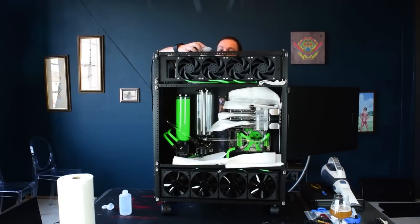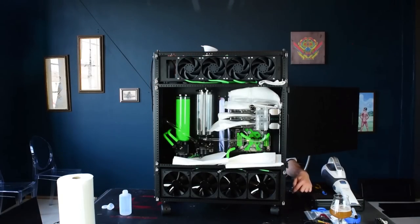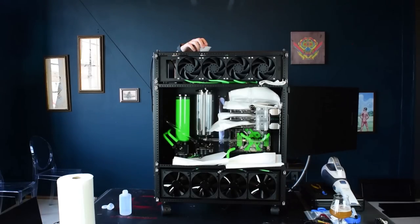That's the case with every power supply I've ever used. But there is, of course, a way around this. You can trick your power supply by plugging the 24-pin cable into a false connector with a jumper in it. These are available at your favorite online modding store.